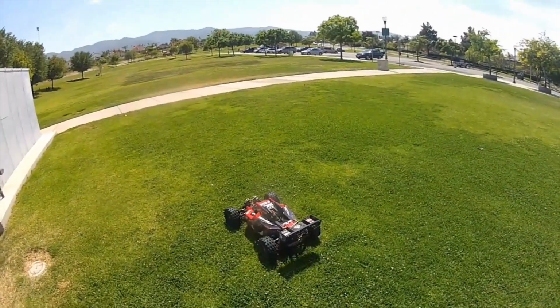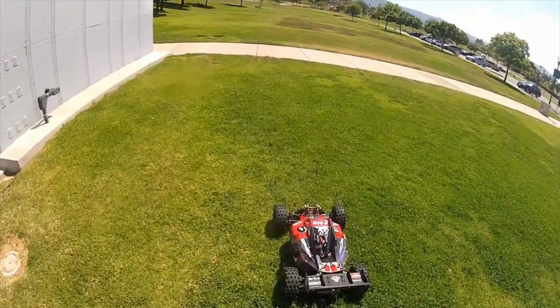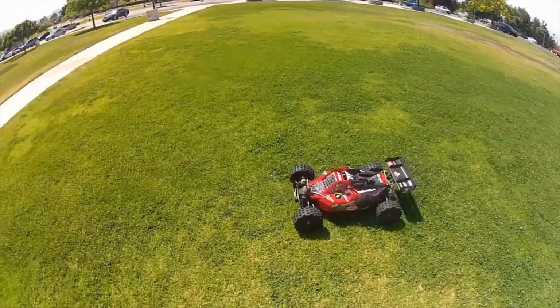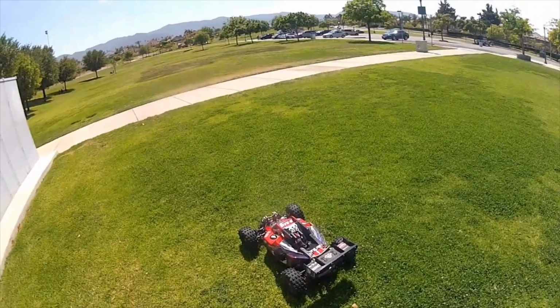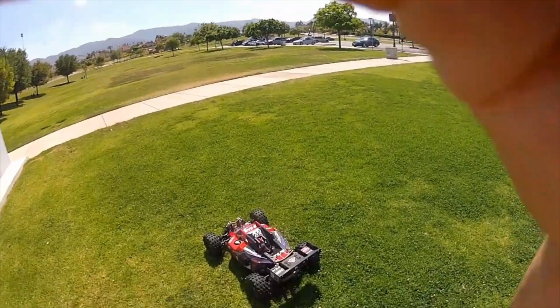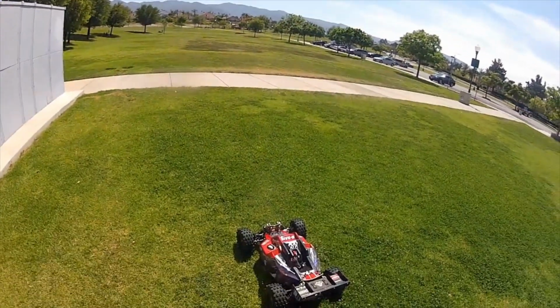Alright people, we're back. I put the rest of the fuel in, so I believe I've got about half a tank. So like I said, after the rest of this, no more 28-to-1, we're going 32-to-1. And we're going to see if that gives me a little bit more power. So anyway,